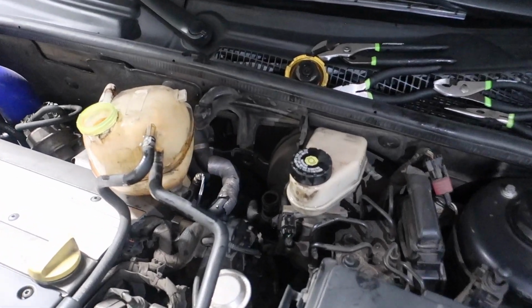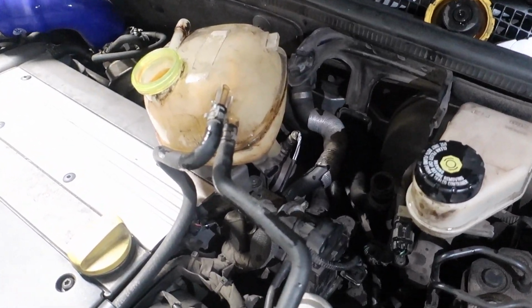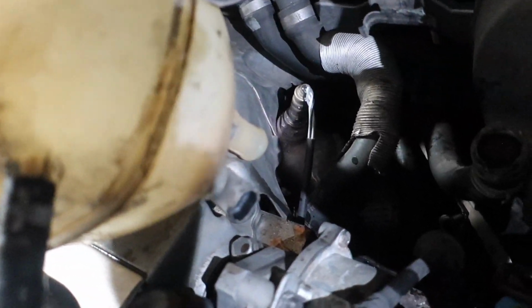I have to show you guys this, and I'd recommend doing what I did to prevent spilling coolant. I tried to pull as much coolant as I could out of this hose by sticking the turkey baster down into that little outlet down there. And I sucked out just enough. Look at how close it is. It's like a half ounce more and it would overflow.